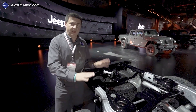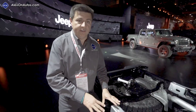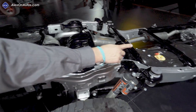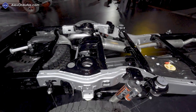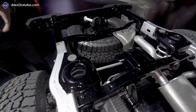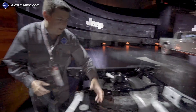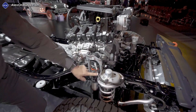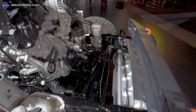Jeep has a complete frame for the Gladiator here on site so we can take a look at things. What you see in silver on this frame has been changed. About halfway across the cargo bed all the way into the passenger compartment, we see a reinforced frame section. That helps prevent the sort of bending seen in other trucks that haven't been off-road reinforced when you're really walloping them out on the dunes. We also get updated links, different sway bars, and different springs all the way around. Up front, we have Fox remote reservoir shocks, with the remote reservoir placed right under that front skid plate so they're not affecting suspension motion at all.